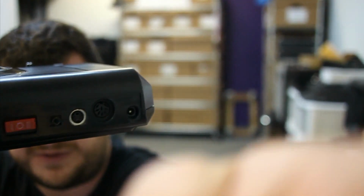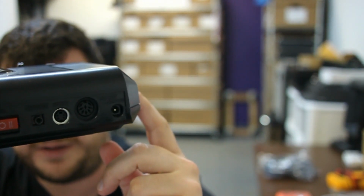And then next to it, of course, is an S-video output. So overall, this thing is pretty cool. I mean, you have the region mod, you have an S-video mod, and all of it done without cutting the plastic, which is really important to me because it preserves everything about the Genesis, or about any game console. So many of these mods get redone, and then you end up with a hole in the back, and all of it sucks. But not this. Just the EXT port was removed, and the RF was removed.